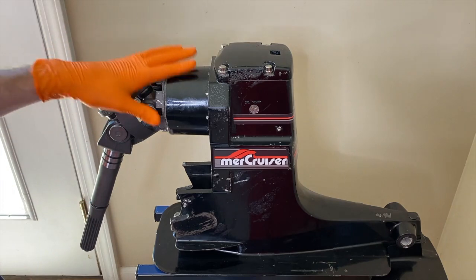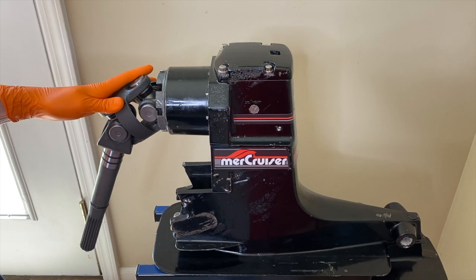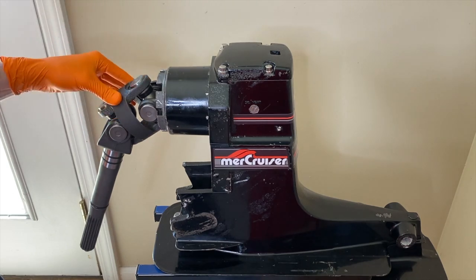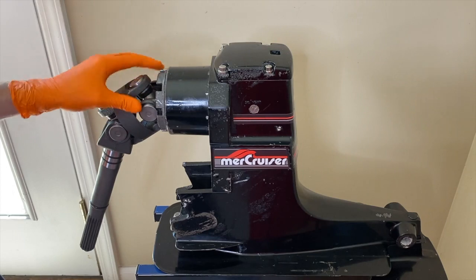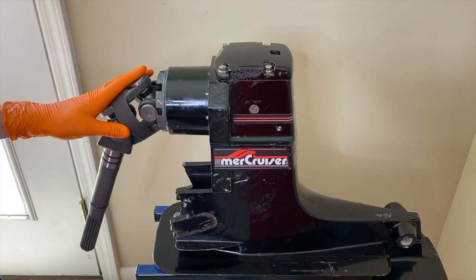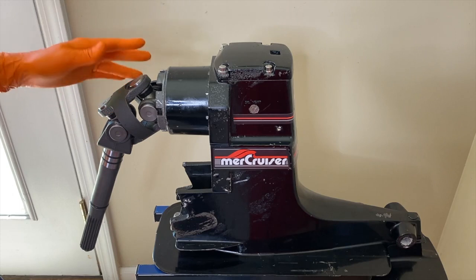I've repositioned the camera. Here is our out drive, the upper unit, and feeding out of the upper unit is our U-joint assembly — short for universal joint assembly. You can see the internal crossbars and the uniquely engineered inner mount that holds them. On the outer portion is our larger yoke shaft, and inside is our smaller U-joint. The entire design and purpose of your U-joint assembly is to transfer mechanical power between two shafts when they are at a specific angle from one another.